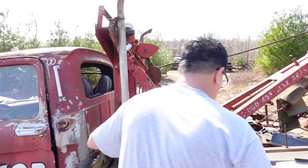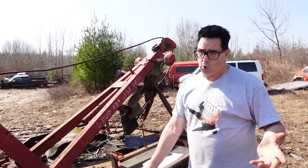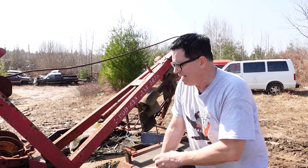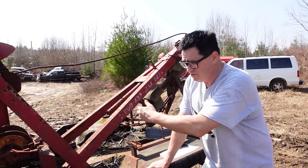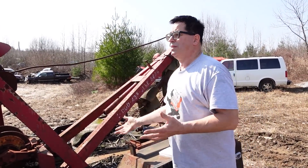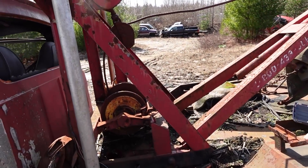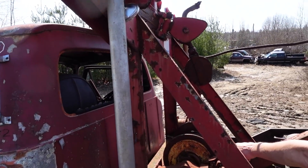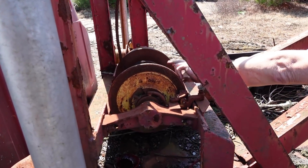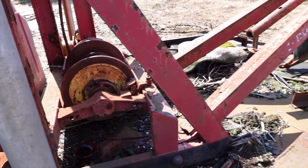The bed or tow unit on this thing is homemade. Today, companies like Holmes will sell you a pre-made tow truck unit that you bolt onto your straight truck and go towing. This one is totally analog, totally homemade with I-beams and H-beams. There are no hydraulic cylinders here — this is completely analog, with a pulley wheel and cable driven by an electric motor. Old-school pulleys.